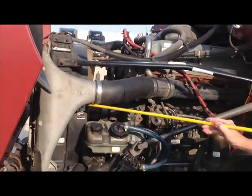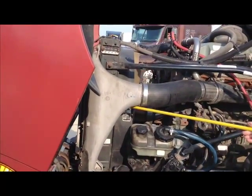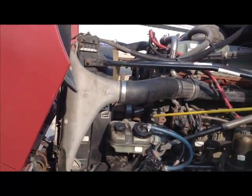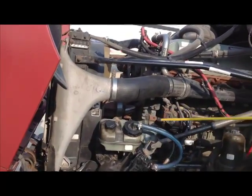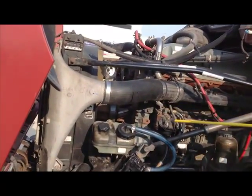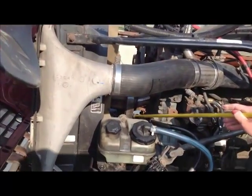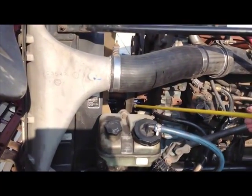You want to go to your radiator on this side. Make sure it's secure, no missing nuts or bolts, not cracked, broken, or leaking. Now, the best way I've found to do this is to stay next to the motor and work your way up. So go to the belts again on this side. Not cracked, broken, worn, or frayed, no more than 3/4 inch play between the pulleys.